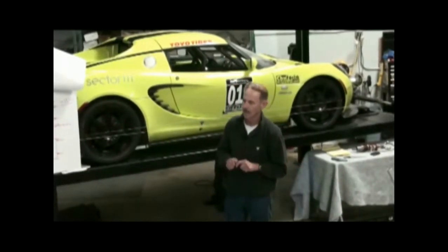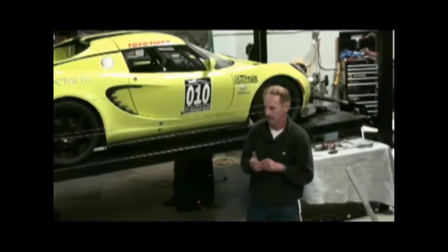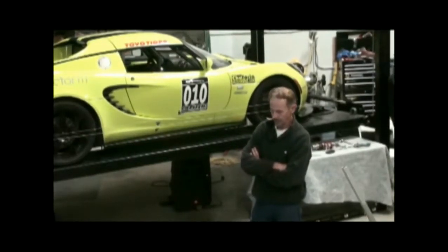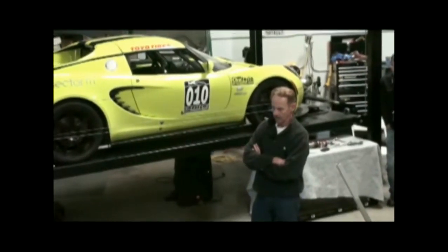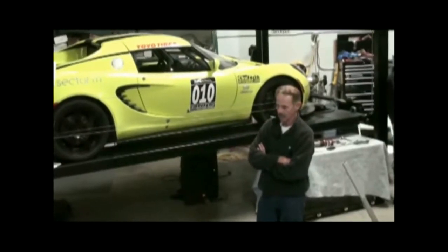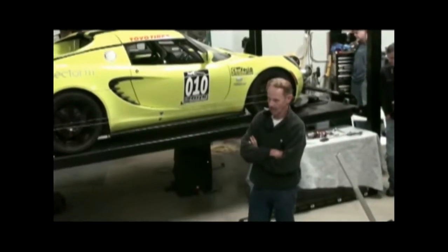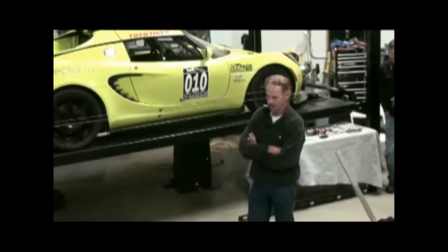I run minus two and a quarter camber on the back of my MZ. After 15,000 miles of wear on the same tire, you can see how much wear difference there is — not a whole lot. It's matching differences within caliper measurements, rotating from side to side. You wouldn't even be aware of it running about minus one and a quarter across the back. Most of my mileage is street because tires never see the track.